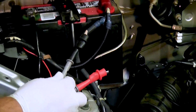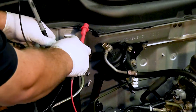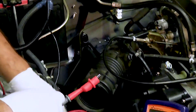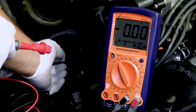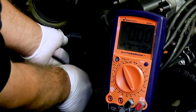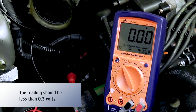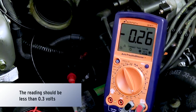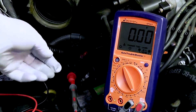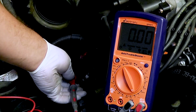For the positive side we're going to do the complete opposite. I'm going to put the negative test lead on the positive post of the battery, and I'm going to put my positive test lead on the positive side of the starter — nice and tight, getting a good clean connection. On this one we want to see a voltage drop less than 0.3. That's awesome. Our voltage readings are actually pretty good — there's almost zero resistance on these wires, which makes it perfect.